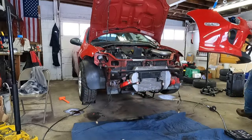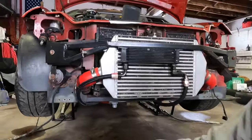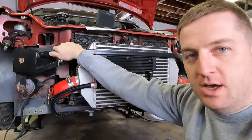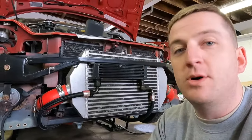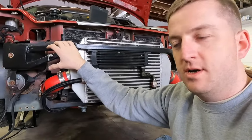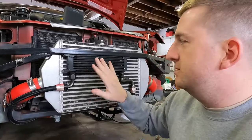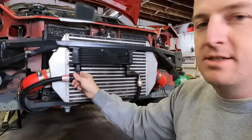I was able to get the front end off. For those of you who have never been to my channel, you're probably wondering what is going on with my front end. I built my own custom crash bar — that's what this black thing is that goes all the way across. Reason number one: when I upgraded to an aftermarket intercooler, you have to delete the stock crash bar. I drove the car for about a year with no crash bar. Reason number two: I needed a location to mount my oil cooler. I drilled holes into the underside, tapped it, bolted it, and she's rigid.